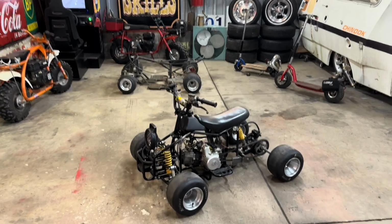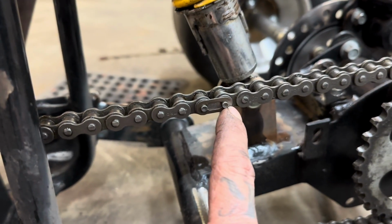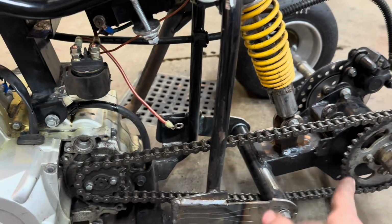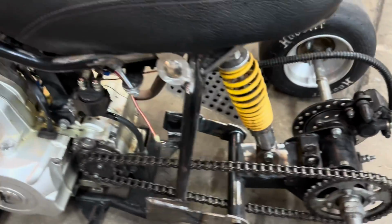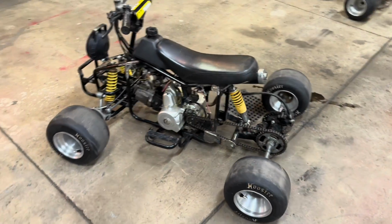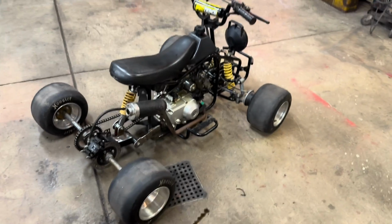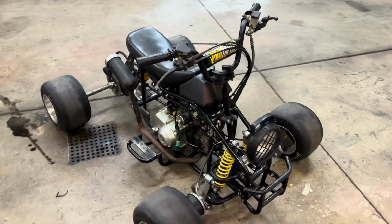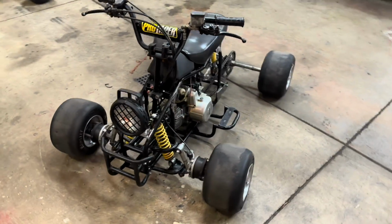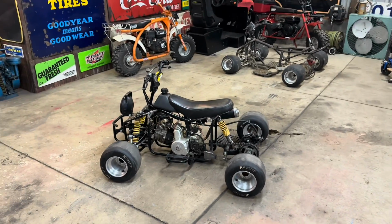All right, so give you guys one final look before I call it a night. And one thing I want to mention before I forget, on your master link, you always want the open end of your clip facing away from the engine, just so as it rotates, it has less of a chance of catching anything or popping off of there. But I'm going to drive the hell out of this thing for the next couple of days, see if there's anything I need to fix or change on it, see if I'm happy with it. And next time you guys see it, we're going to blow it apart, give it a nice paint job, and make it look a little cooler. But see you guys next time.